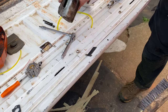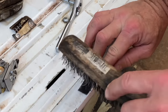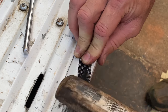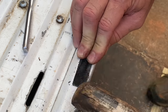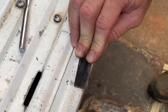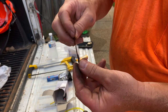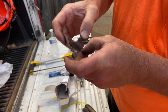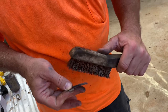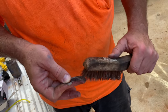I just ran the wire brush over that for a little bit. But right here is what I really want to clean — let's see if I can break some of this loose with a wire brush, and then maybe do some carb cleaner and some compressed air. Let me see if I can break it loose with the wire brush first. With just a wire brush, I got this thing cleaned out pretty good. Got one little spot right there I'm going to work on just a little bit more. But if I'd had some carburetor cleaner, I probably could have soaked this and got it off easier. We're going to keep working with this and throw all this back together.